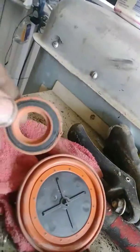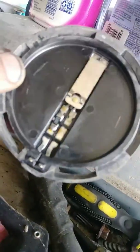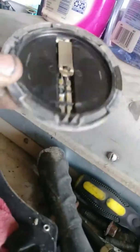P0441 is the purge solenoid and P0440 is the one for the natural leak detection device. This code is triggered by essentially a set of diaphragms in it with a little piston valve. This diaphragm will start leaking since it has holes around the edge of it. Either that, or the top has a little micro switch in it — the micro switch will go bad and that's the end of the sensor. See the little connections there?